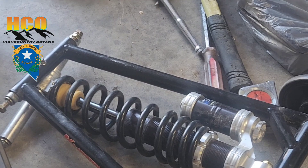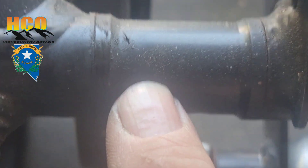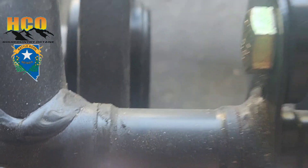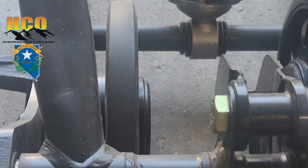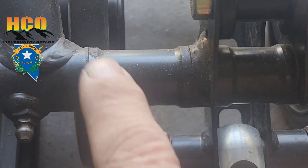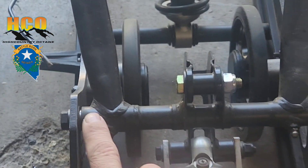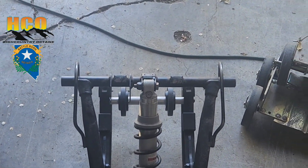Last but not least, something else I think I'm going to do: as most of you may know, this is the bottom bar on your front swing arm. There's a split in that section to allow the bars to pivot individually for your T-motion. I haven't heard of anybody doing this — John Wilmer from Sled Head Racing has been helping me and he hasn't heard of it either — but I'm going to weld up that seam and make it a solid bar all the way across to eliminate any twist possibilities on the front of that swing arm.